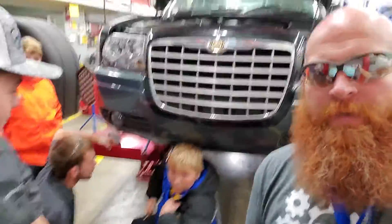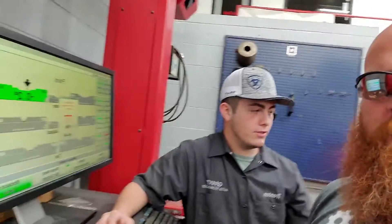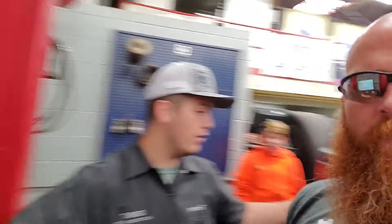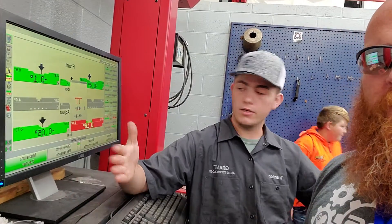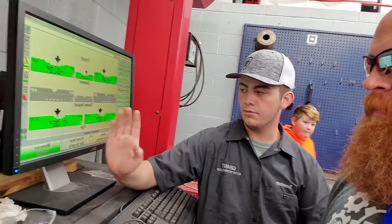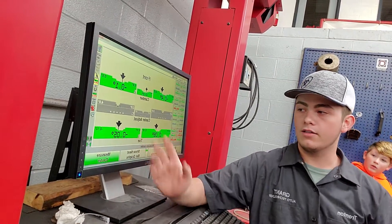We got a couple under the car here. Hey Trent, will you tell us what we're working on? We're working on this Chrysler 300. We're basically setting the toe out on it, on the tie rods, and then we're going to pull it in, loosen the jam nut, and then adjust the tie rod — pull it in like this right here, for example. It's good on the screen now and all we're doing is pulling it in for correct alignment and showing them how to align everything on it.